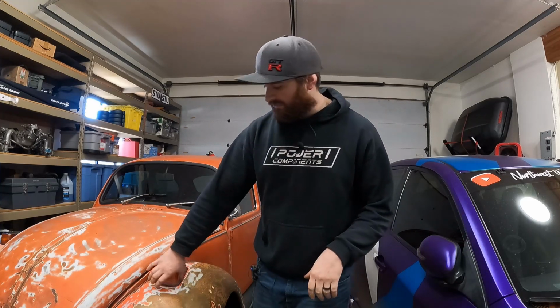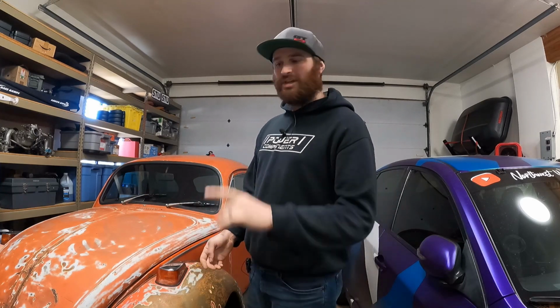At the back, we fixed the brake lights, the tail lights, and the turn signals. A lot of the issues were connection issues between the bulb and the socket contact because everything was corroded and worn out. So I just took a nice wire brush, cleaned up the bulb contacts and scratch cleaned the contacts of the sockets in the car, and everything started to work. The only issue I still have is the high beam headlights are stuck on because the flasher switch behind the steering wheel is broken, but he's going to have to buy one of those and replace that as well. Otherwise, everything else is working and this car has all the stuff needed to drive it on the street. Now let's go take a look at that exhaust and show you guys what we got going on.